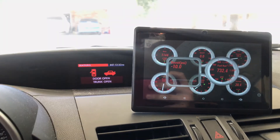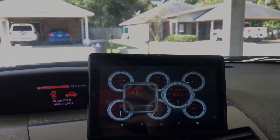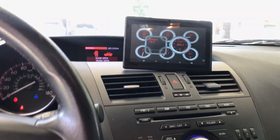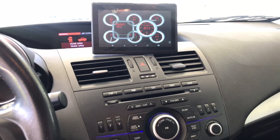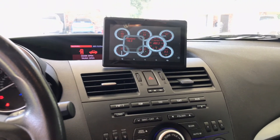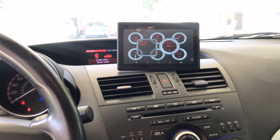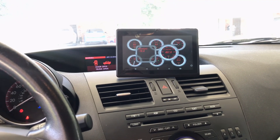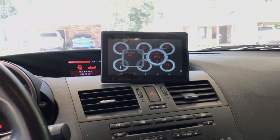So if you want all this data, you don't have to get a V3. You can just get a V2 to load and log maps, and then buy a $20 tablet and a $20 OBD2 adapter and read a bunch of data. I will say though, this one was a cheap China one — it was $20, it's not the best. I think if you buy an OBD Link MX — I can't remember correctly, but it's a more top-of-the-line reader, around $50 to $100. It's worth it because you'll be able to read more important parameters, such as measured AFR and knock. If you buy the cheap China knockoffs, you'll be able to read data, but you won't be able to read certain sensors like knock.